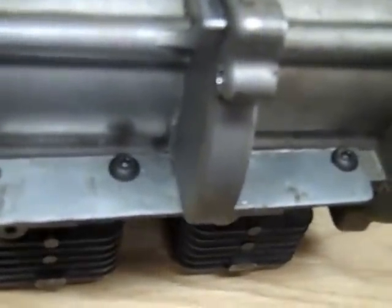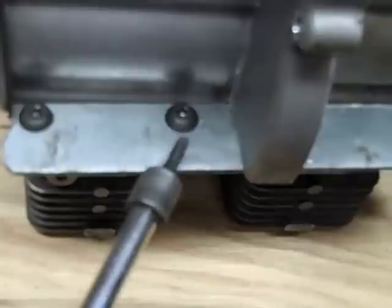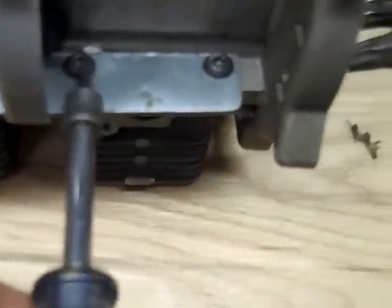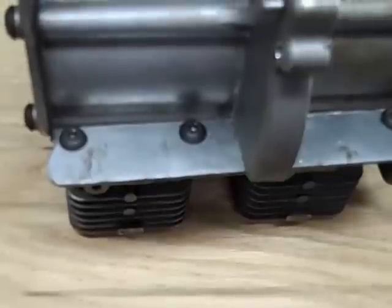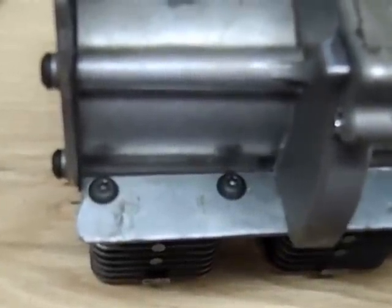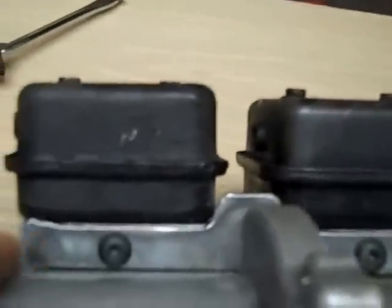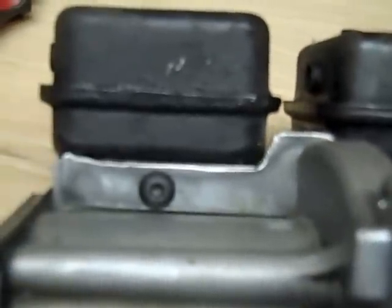Here's the engine upside down. You can see some flat bar here that I made and tapped out to get a real stable marrying of these two housings together. I utilized the screws that actually hold the head of the motor on — in the weed whacker they also served as a mounting for the plastic housing. All I need to do is back out these four screws and I can take this bar off. I did the same thing on the other side, though I had to reconfigure it a little differently because there are only two bolts on that side that hold the head on.